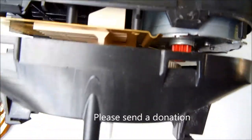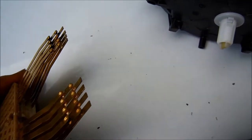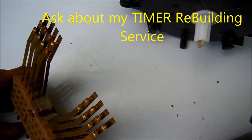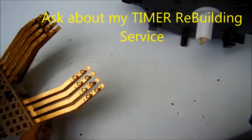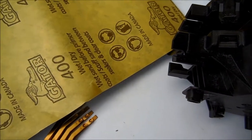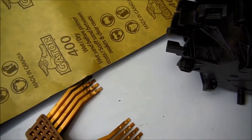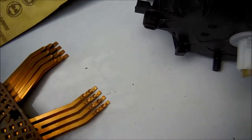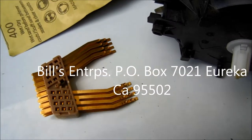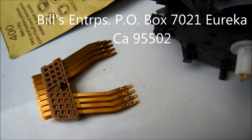Basically what I do is spread a little silicone in the moving parts — avoid getting any lubricant on the points. You can use contact cleaner to clean the points up. I just take some 400 grit sandpaper and lightly buff the points clean, take off any corrosion, and put it all back together.